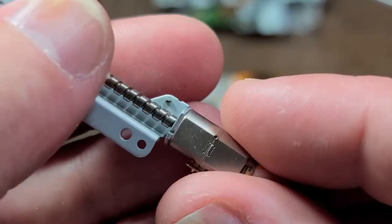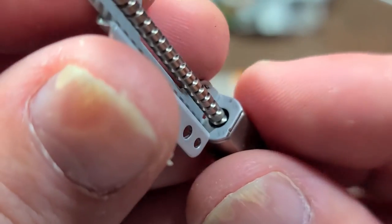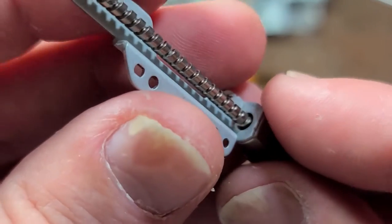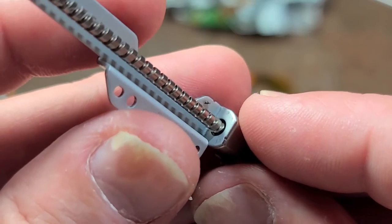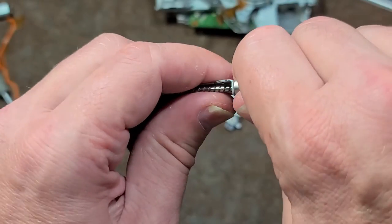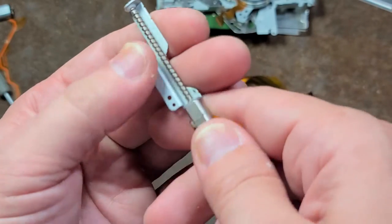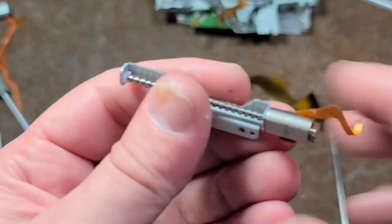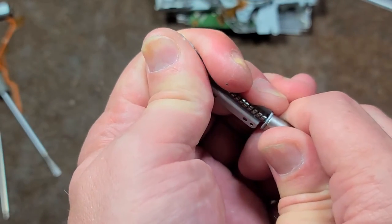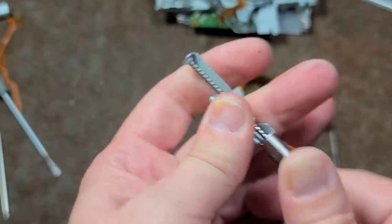And there's our tiny little stepper motor — I can feel the cogging. What's interesting is they actually spot-welded the support plate to the motor — it's so small they didn't have space for screws at all, so they just spot-welded it. Probably not the strongest spot welds in the world, but even for a little device like this you'd actually need to use pliers — it's surprisingly well held on there. Just a couple of little spot welds, and they really work.